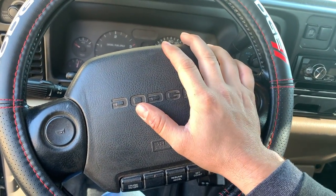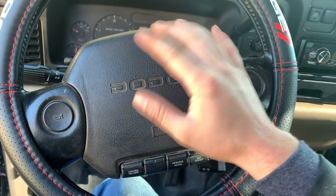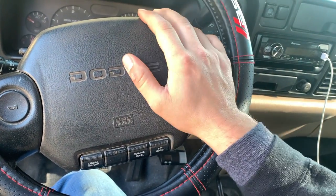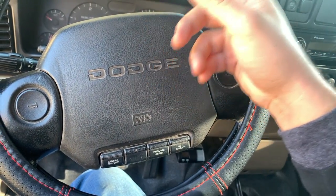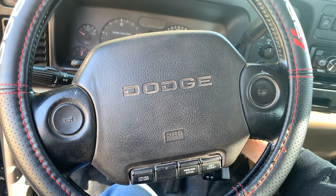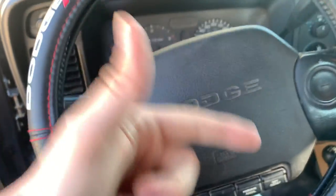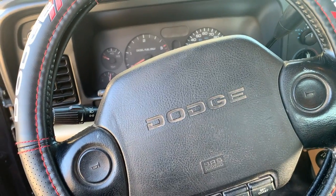Let me show you what I mean — try to turn it over. Truck started totally fine to drive it up there, drove great. But we get up there and the truck is cranking ultra slow, super slow. I thought the batteries were new like he said, but maybe it was just a battery, so I went and bought two new batteries — four hundred dollars later — truck is still cranking just like this. Eventually after two or three tries it speeds up and fires off, but it does that for a little while before it actually starts.